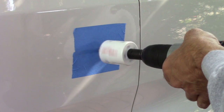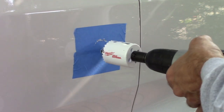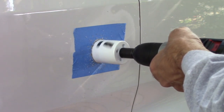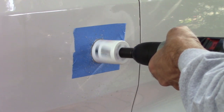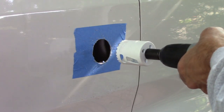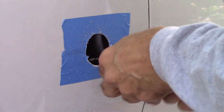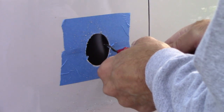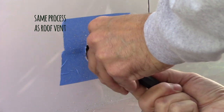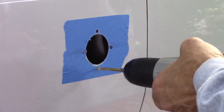I really wanted to hook up a 110-volt shore power plug just in case we have hookups at a campsite to take advantage of the 110 power. Rather than string an extension cord through one of the doors — which would leak water and cause other issues — I decided to install a shore power plug on the exterior of the van. Make sure you clean all the burrs off the rough metal cut with a deburring tool. Be very careful because that metal is razor sharp after you cut and drill the holes.